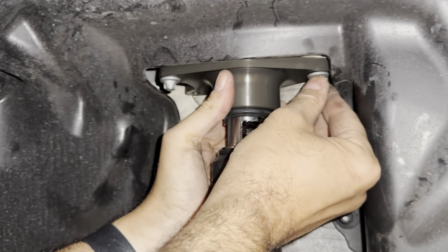It's slightly toed in. It felt stable. It didn't have that really bitey turn-in, but felt really good. I could probably go with a little bit more negative camber, about another half degree up front, especially on my front left, which is the tire that gets hammered on the shoulder. The wear is coming a little bit further than I thought I'd go, so half a degree on the front will be good. Back felt great. That's it. The Shockworks guys did good on the coilovers, CRS tires felt great, and all up it's a good setup, good handling.